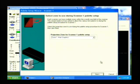Within scanner 1, you can have up to 20 different projection zones. For example, if your scanner can hit both a graphics screen and mirrors placed around the screen, you might set projection zone 1 so it's only as big as the graphics screen, and set projection zone 2 wider so it can also hit the mirrors. The color palette wizard needs to know which projection zone to use so it can show you some color test patterns. Most people will leave this choice set to zone 1, the main graphics zone. Color test patterns will then appear wherever your main graphics appear.